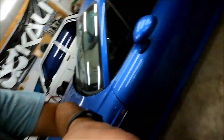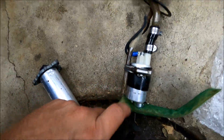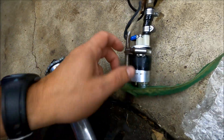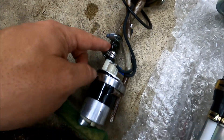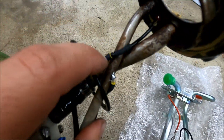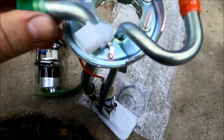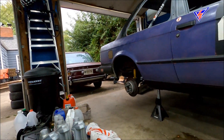I think this is going to make a difference — at least I hope it is. Here's our nice OEM replacement pump, looking fresh. Here's what came out. This was, as I'm told, a trackside repair — the fuel pump died during the middle of a race and they had to run to AutoZone. This AutoZone pump is not rated for the E30, and that's why we're having the breakup issue — fingers crossed that's why. They had it hose clamped on, cut random hoses, and the sketchy part is the wiring — heat shrunk and soldered together, and the ground is just soldered to the return line. This fresh OEM unit should do the trick — it comes with nice new nuts, washers, and rubber seals. Hopefully that's the ticket to a nicely running race car.